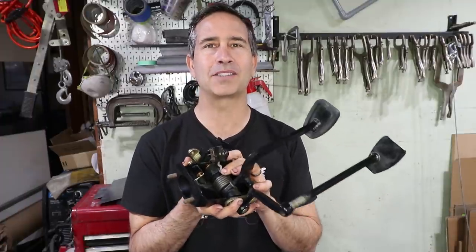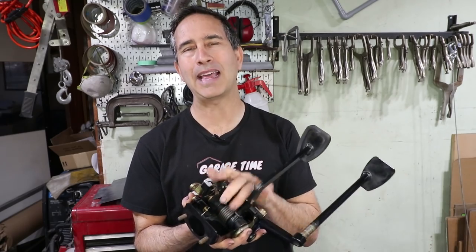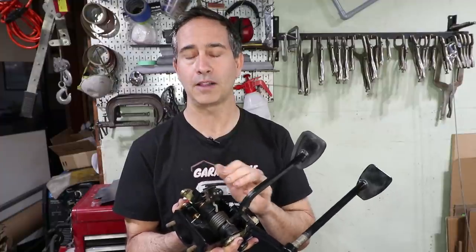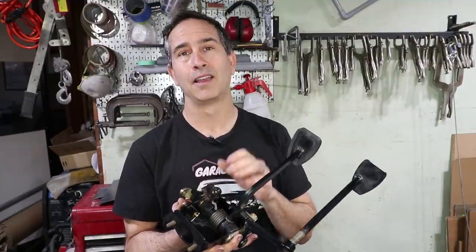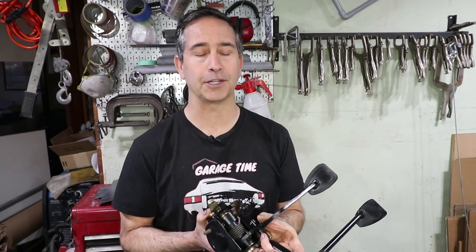Okay, this pedal box is the stock pedal box. It's designed for a single master cylinder. I mean, that master cylinder does have two circuits, front and rear, in case one circuit was to fail, but it doesn't have adjustability in terms of the front to rear brake bias. Once the piston sizes are fixed, that's all you get. You cannot really change it.